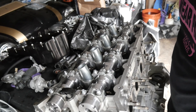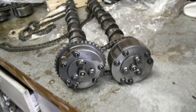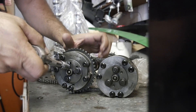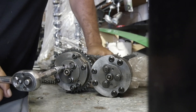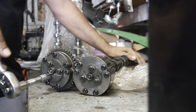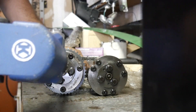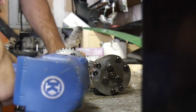Everything is buttoned up and ready to go, now we can move on to something else. When we initially took the whole engine apart we did not take the cam sprockets off, so I'm going to go through and take these off so we can get them transferred over onto the new cam. Using our 10 millimeter socket we're going to see if we can break these loose. Since I didn't take these off when they were on the engine they're a little harder to get off, so I'm going to use the impact to get these off. And that works super fast.